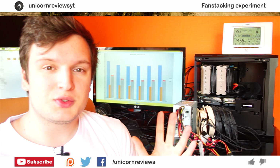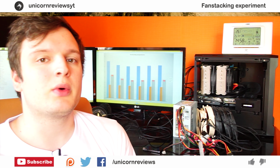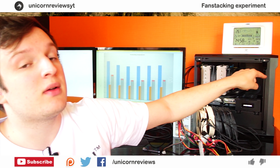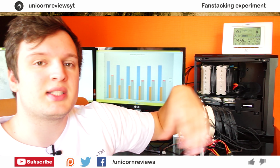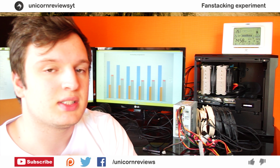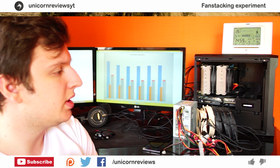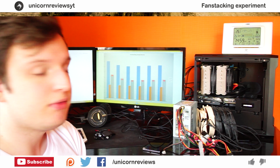Right then, before I do the conclusion, I have to say I did rerun the first test because I forgot to take the front panel off in the first test without any of the additional fans. So what I said about the 74, that's wrong, it's actually 71. So yeah, you can save 3 degrees Celsius by taking the front panel off of the Fractal Design Define Evolve case.